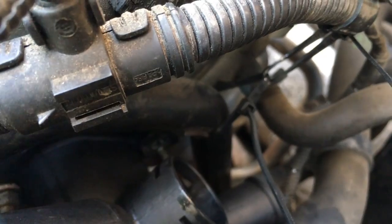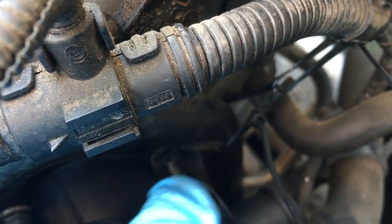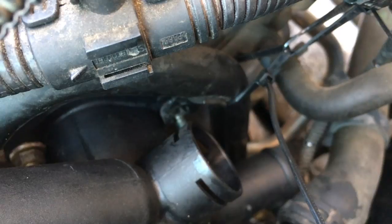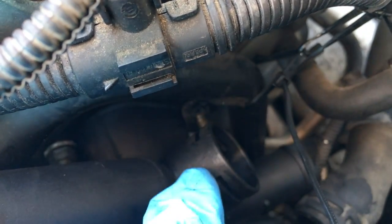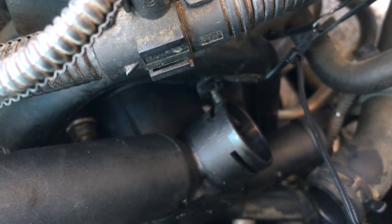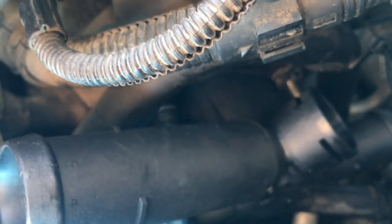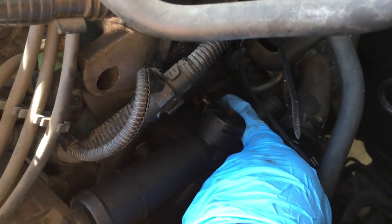Hopefully you can see what I've got going on here — I put a few zip ties in to hold the hose out of the way. Pull it up out of the way so I can get the bolt on in the back. I recommend using zip ties to hold this pipe up so you can get the bolts in behind the bracket attached to this hose that cannot be removed. Pull the hose up to get the bracket out of the way, get the stud in, then tighten finger tight first before using your socket. The other bolts back here are both 10-millimeter. Now that I've got that on, I can put the other bolt on top that holds the bracket in place.